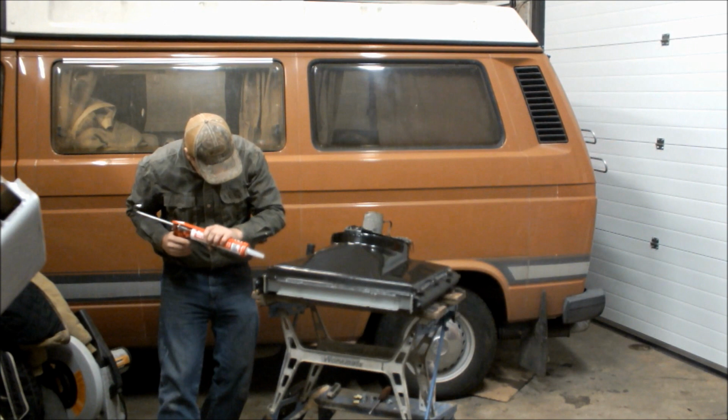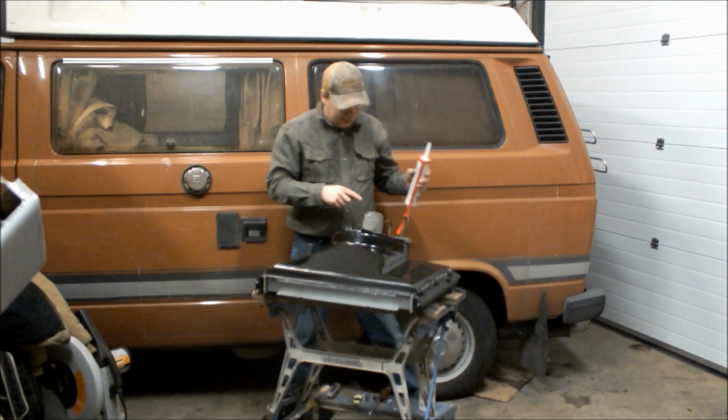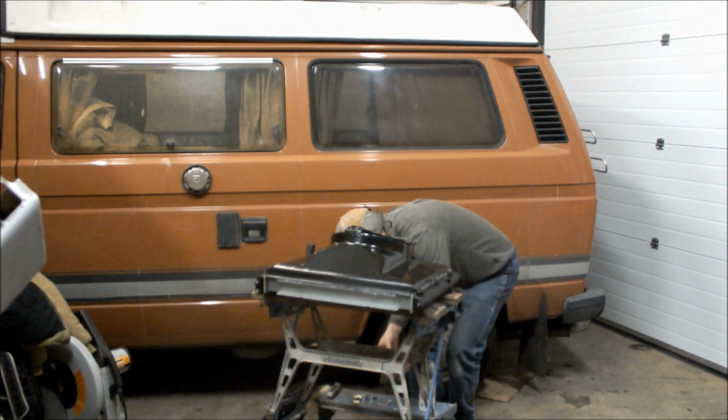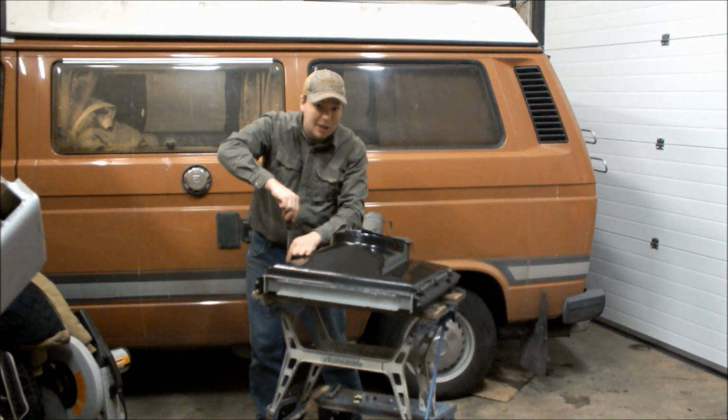Now, you can put in the comments below here, because I've never done one of these before. The holes in the radiator that hold the cowling on came completely untapped. Now, I'm guessing they're supposed to have some kind of self-tapper in them. But I don't like the idea of that. So what I've done is I've actually tapped it to 1/4 inch, an imperial thread. The reason I went for the imperial thread rather than a standard metric one is because I always find that if you've got an imperial thread like 1/4 inch into plastic, it'll hold a lot better.